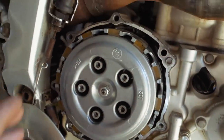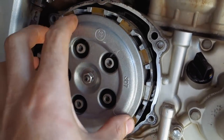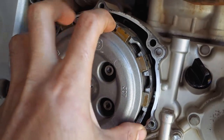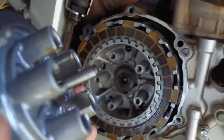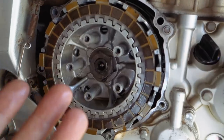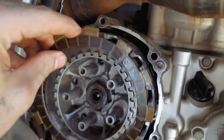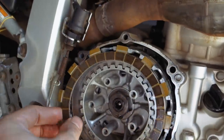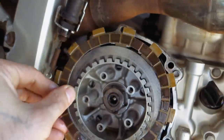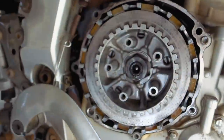We've got the pressure plate here - all the bolts and springs are off. You don't need to take that center bolt off. The pressure plate can feel like it's stuck on there, but you can just fudge at it - and there you go. The pressure plate comes off, and there's a little slider in there. Then it's just one after the other removing the discs and plates - there's no particular arrangement other than once the fingers on the disc fit in, it's good to go. You want to end with a clutch disc as your last contact on the back of the pressure plate.